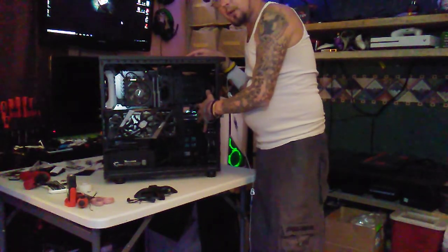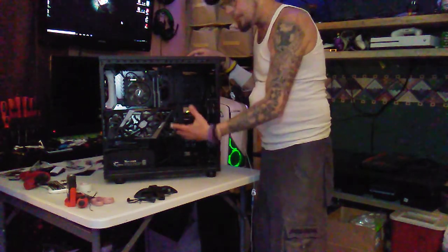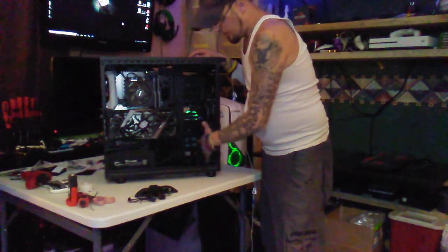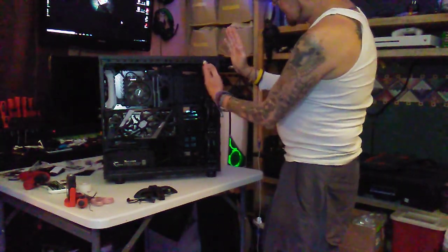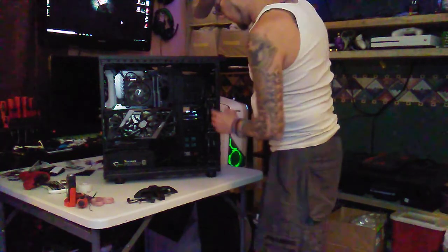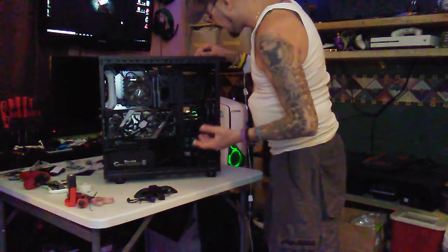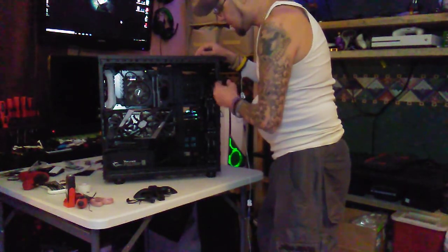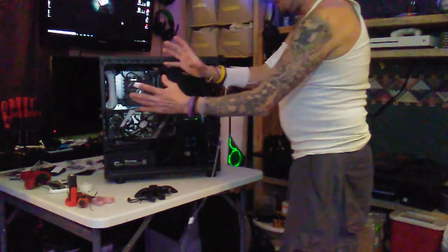I kept two of my Cooler Master fans. They're 140 millimeter. I left them mounted on the inside. I had to take them out to get to the screws for the front fans, so I had to reinstall the 140s again, and with fans on the outside and fans on the inside, they're all real close. The 140s were clicking, so I got some spacers and nuts and bolts, and put spacers in between, and created a little quarter-inch or eighth-inch gap between the metal case frame and the fan. And they spin freely, so that should suck air in.